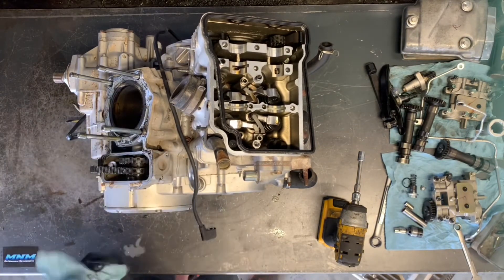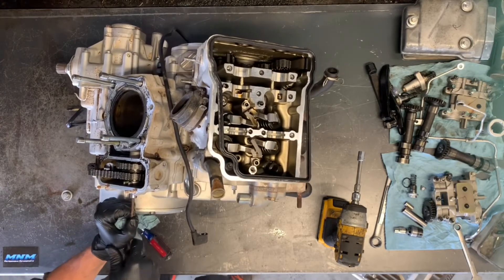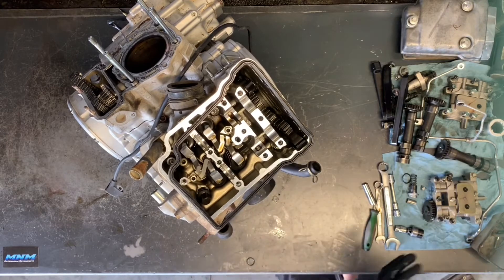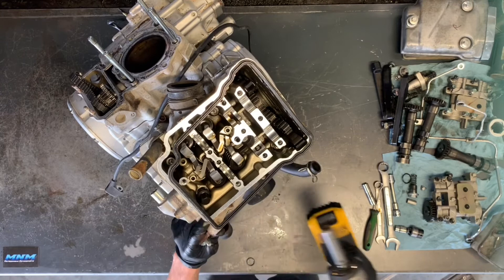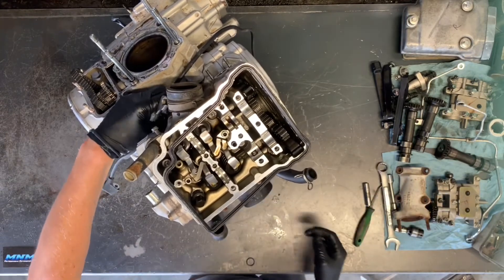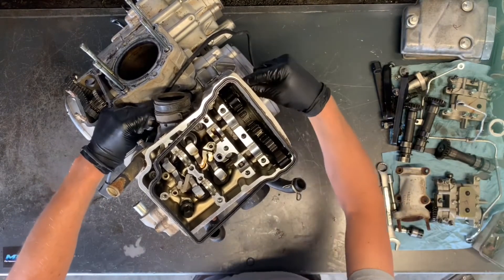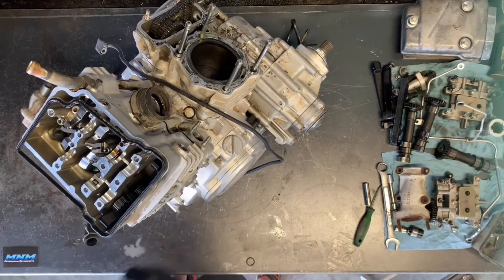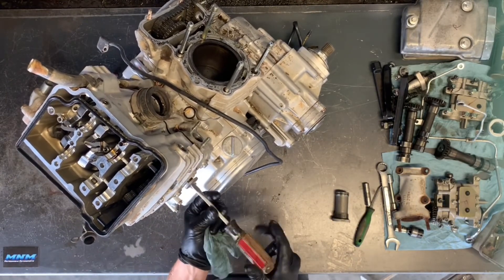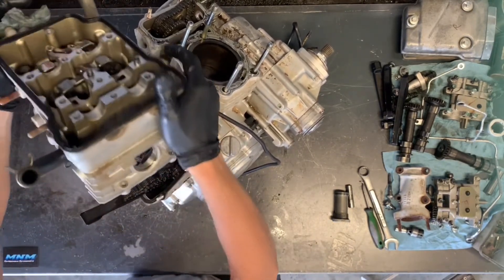Our chain is loose and there's a separate chain that goes down into our crankcase. Remove this cap, use a screwdriver to put some pressure on it, and then a shaft comes out and the sprockets will drop down. Going up to the front, we've got the front exhaust manifold — 12-millimeter bolts again to remove that. Those are removed, go ahead and pull this off. We've got our cylinder here with a 12-millimeter bolt on the front and back of this motor. Check the sides — we've got these 10-millimeter castle nuts that we already loosened. On this side we've got your spark plug tube. We've got this gear that holds the cam chain. Remove those so the guides can get out, and go ahead and lift this front cylinder head off.